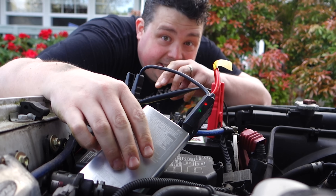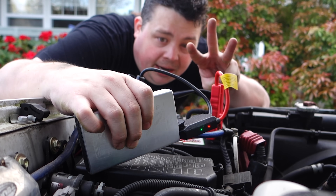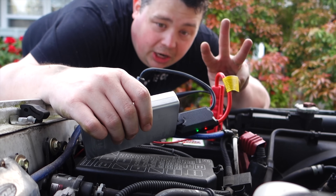But it just died — the truck didn't stay running, which means the charging system didn't kick in. That's not good. It did start it, but the charging system in the car didn't keep it running. Maybe the alternator is going bad. It did say you could try up to three times with the battery pack but recommended not doing any more than three. So let's try it again.